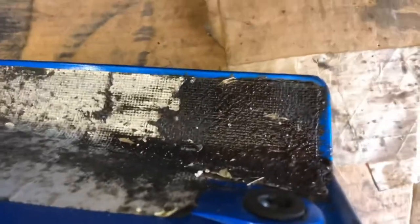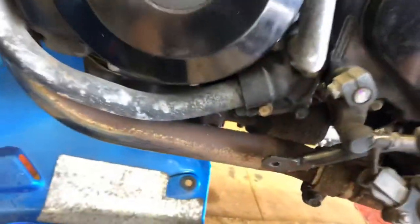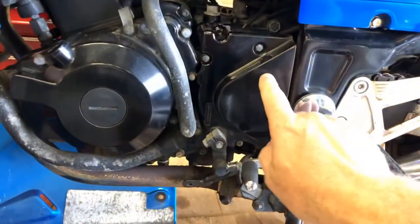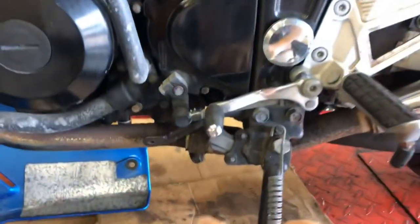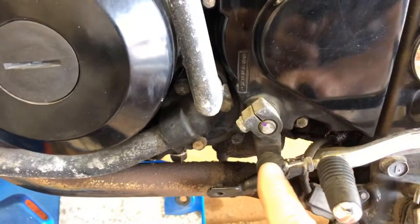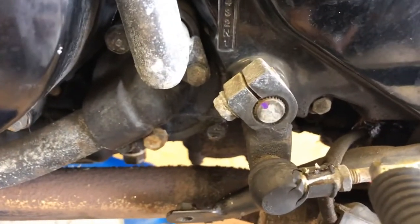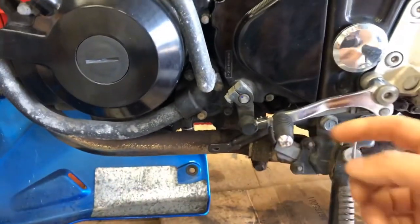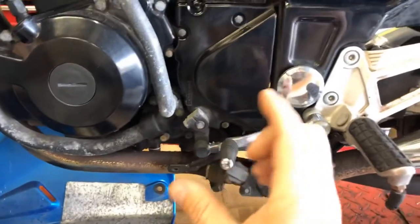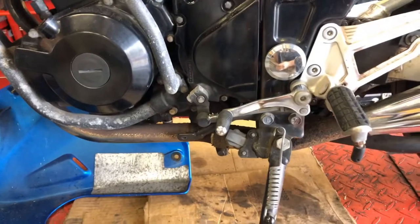There you can see the oil leaking in there — you'll probably get a better view of all the greasy goodness down in there. Your next step is to remove this chain cover. I like to mark where the split is on the shifter — I use a Sharpie marker. You can also use a center punch, which will make sure your shifter is still at the same alignment because this thing is splined. You can move it to adjust the shifter up or down. Since I'm happy with where it's at, I'm leaving it there.